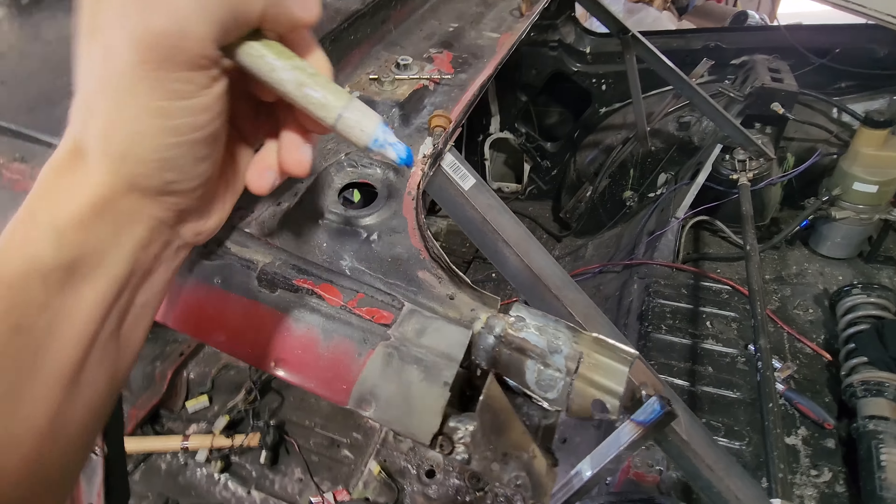We need to take this off yet again and make some more decisions. I also took measurements of the quarter panel so I know how much I have to work with and don't trim too far back. The best idea is to find a straight cut line — we have this much material and we don't need to go that far back. I'll also need to trim back some of the quarter panel to have space to weld the inner C pillar. More surface rust than the bottom of this panel — I was able to clean it up and get all that rust out. Now we determine where to cut — this would be the overlap, so we line this up. This lower C pillar cap is ready to go.